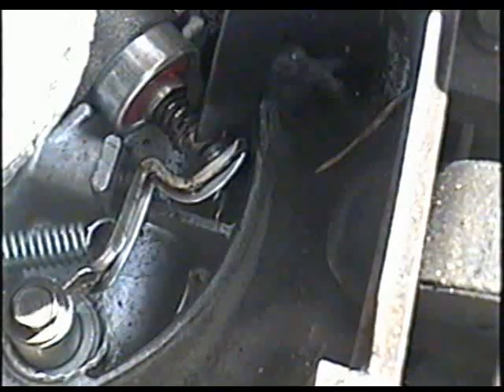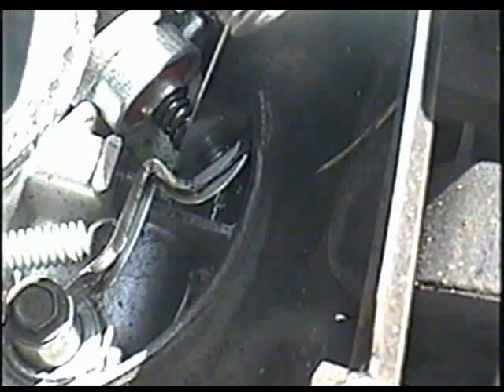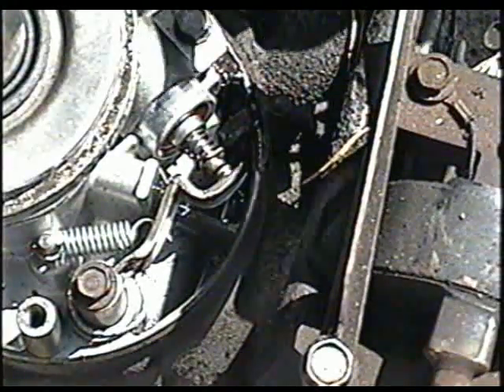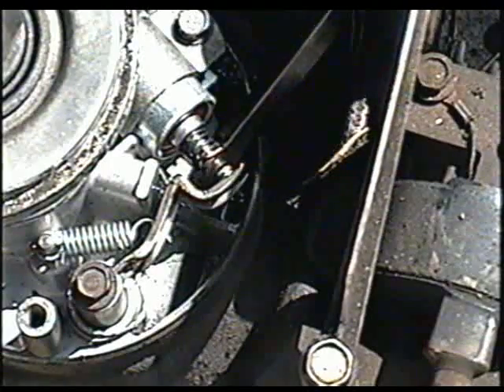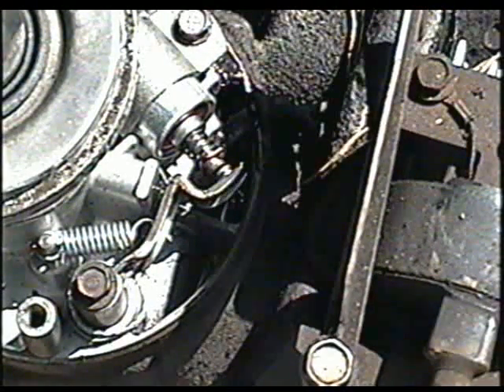Just by putting the gauge in there — I've got them open too much. I'm going to loosen the condenser again and just push it up with the feeler gauge in between the points and the condenser, then tighten up the bolt. So now I've got them set at 20. When you put the gauge in, it just goes in snug — not too loose or too tight in there — and that's perfect.